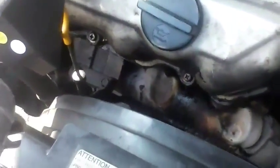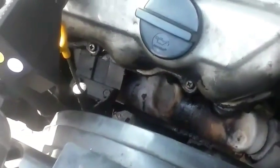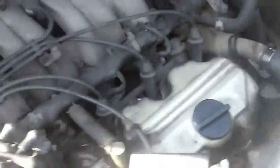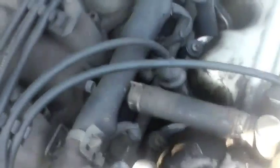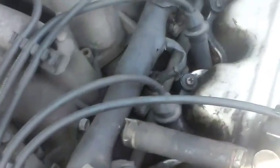I got sidetracked when I was originally filling this radiator up with an alternator belt break. We've got some episodes where it's gotten a little hot — not at stoplights, but in a traffic jam. If you're just driving around town ordinarily without any real delays, it's fine — it never moves off normal. But if you're in a traffic jam, maybe moving 300 feet in five to ten minutes, it's gonna overheat.